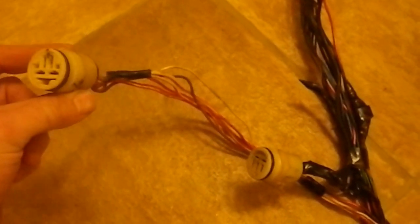The EFI main relay is the one with four wires going into it. This 5-wire connector is what interfaces with the EFI harness, and by the way it should be in a different place, so if it doesn't look like mine that's probably right. Coming off from here, everything going this way is towards the engine, and everything going the other way is under the dash towards the steering wheel and all the switches. The connectors I ended up with are: the airflow meter connector, and the coil and igniter connector.